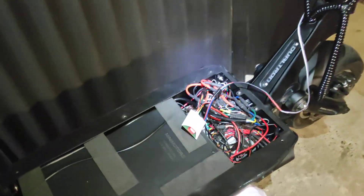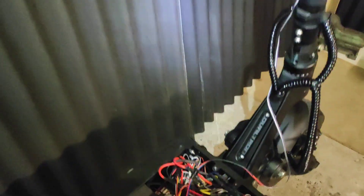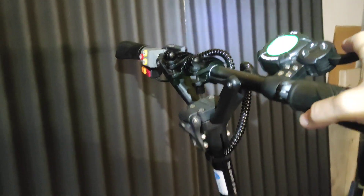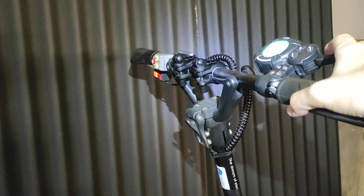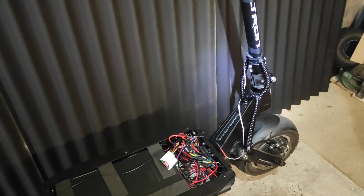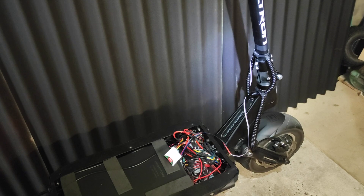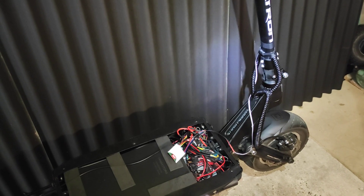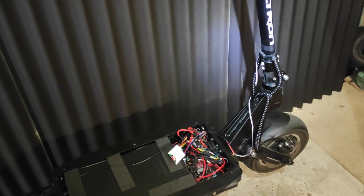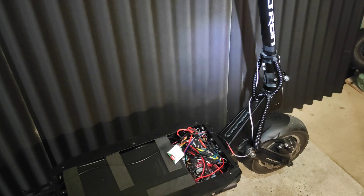I have powered the scooter on and all the switches are in the out position, which means they need to be adjusted. If you touch the throttle, you'll see that the reaction is instantaneous — it starts off very, very quick. It is too sensitive to the accelerator level. I touch the lever very gently and it jumps very quick.